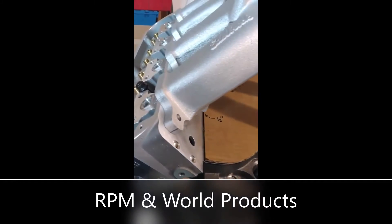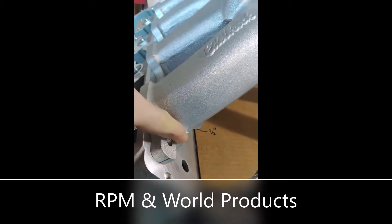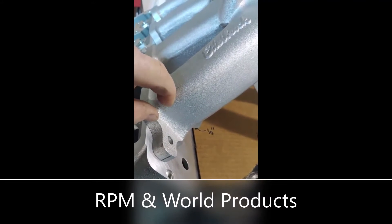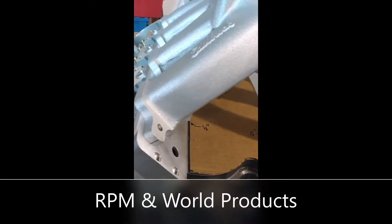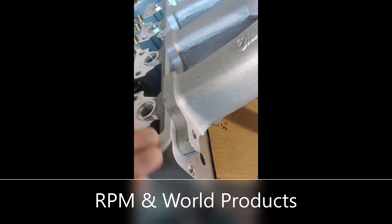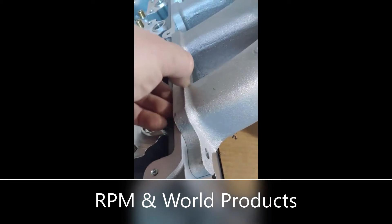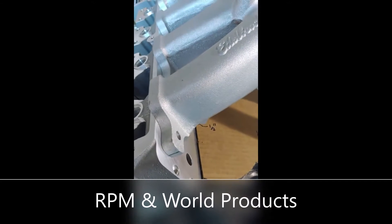What we're going to do is take a little bit out of this area here. We'll cut the manifold and remove maybe a half an inch or so — we're going to take material off of here. As you can see, we've got about a half an inch of actual flange here, and we want to make sure we've got something sturdy to mount to the cylinder heads.